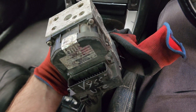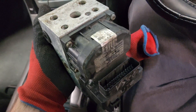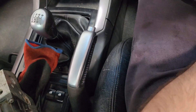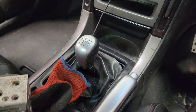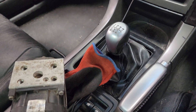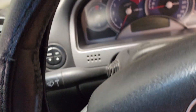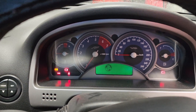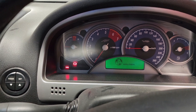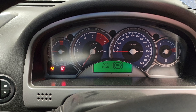So a few weeks later, we've got some sort of skanky looking secondhand, rusted out piece of crap, but we just want to get this car going. All we really need to do — because communication starts straight away as soon as we put the key on — we can see that when we actually turn the key on to this one, we see the ABS. Just the key in the on position, obviously communication is going right away. The ABS module goes out and then the light comes back on straight away because it registers no communication back.